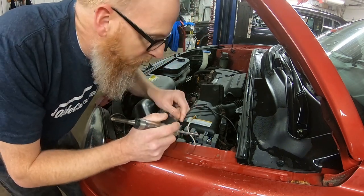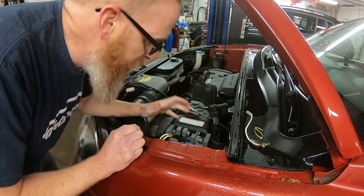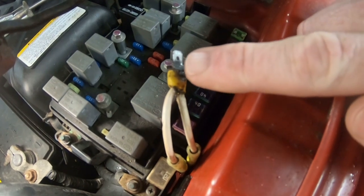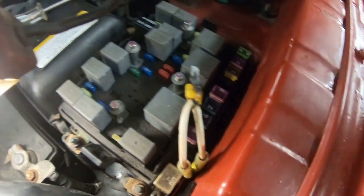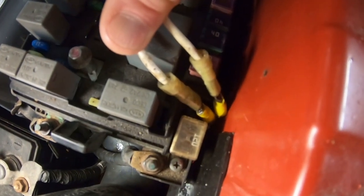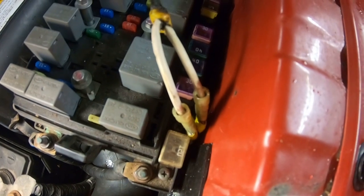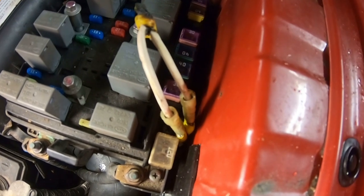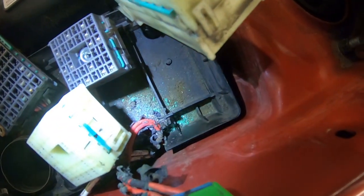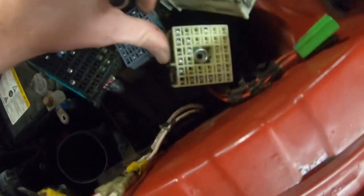Let's take a look and see what's going on in here. We'll get our patented fuse holder out of the way. Before we pull that fuse box out, there's something I want to show you. You can see right here where everything was melted on the end where it plugged into the other side of the fuse. But if we look down here where these two makeshift wires adapt, there's no corrosion and no melting there at all. So right where the fuse is seems to be where the problem is, but it's got to be grounding out somewhere. We're going to start poking some test leads once we get the fuse box flipped. There's a lot of green dust down there — that's from our previous repair. I really don't see anything out of the norm besides that.